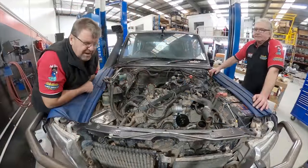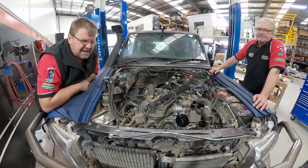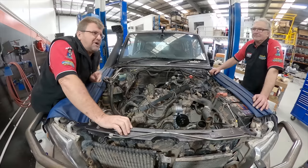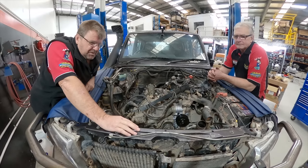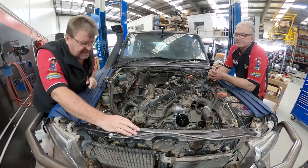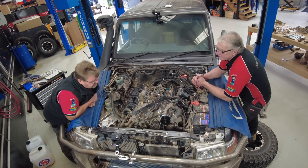Day two — and what I mean by day two is it's actually been two weeks since the last scene, because we had to wait for parts. We had to get the air conditioning condenser degassed, which we've done. So if my hair's grown a little bit or Greg's grown a little bit grayer, now you know why. Today we've got the AC condenser out, a new one to go in, the bird's nest to get out of there, Greg's already put the new viscous coupling on the fan, we'll get the new radiator in, and get cracking.